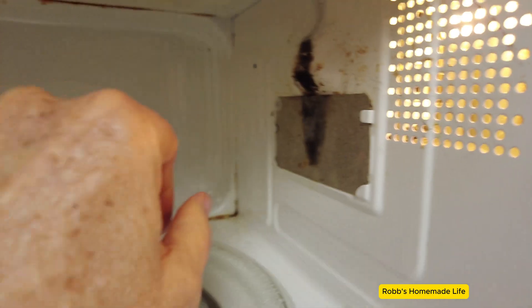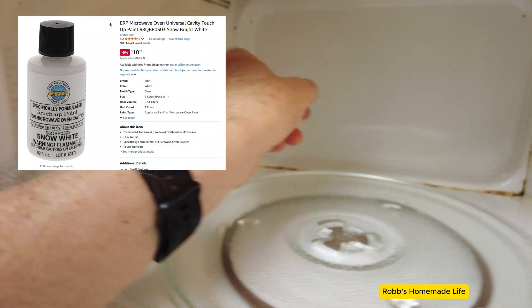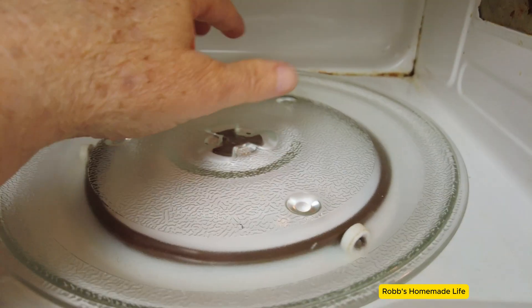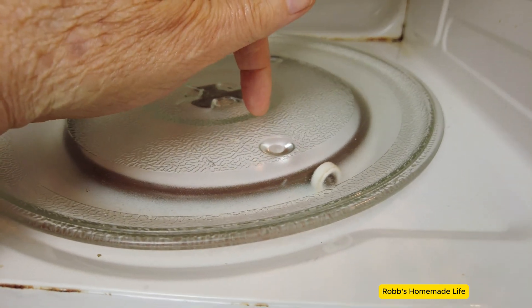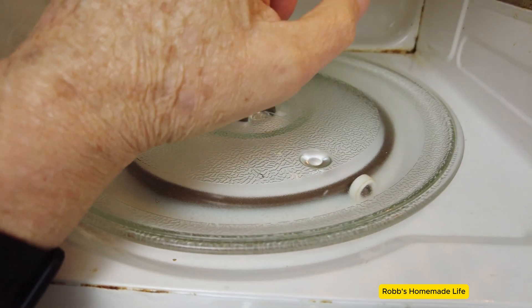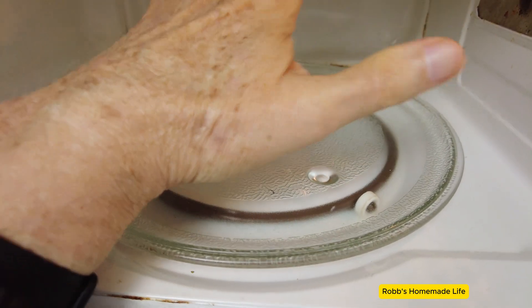The other reasons are: you can have paint coming off inside, and that is also a cheap fix. You can go on Amazon or other places and find paint made specifically for coating the interior of a microwave. So if you're getting paint coming off and it's causing fires, that's one cause. Another reason is if you put a piece of paper towel down and put food on top — most food, if it's moist, is not going to catch fire. But if you have a dry paper towel, it can get a little oil on it and with the heat could cause a fire. If you do have a fire, it's probably best to just unplug the microwave — the air inside will be cut off from the fire and it'll just die automatically.